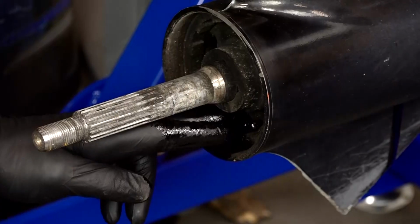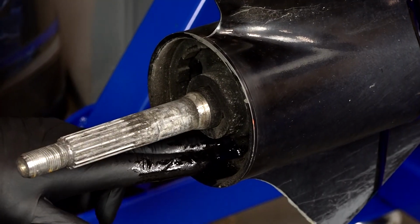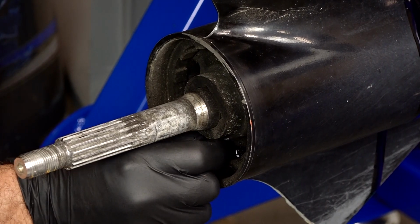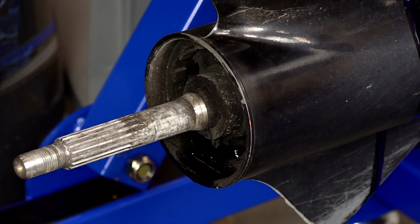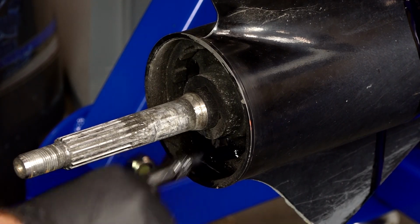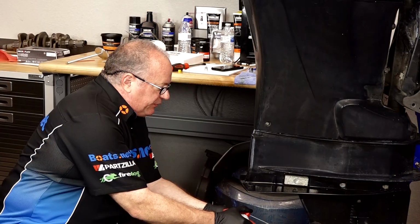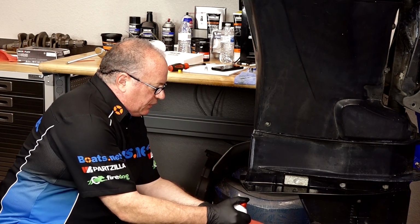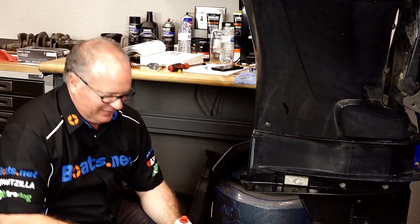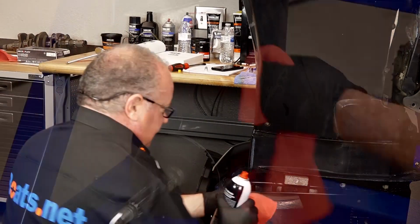Now, just want to unscrew our fill. Get our drain bolt, and in she goes. Tighten that down and just snug it just a tick with a 10 millimeter. Doesn't take much. A little bit of housekeeping. So we don't want to take the boat back to the water, drop it in, and then have a nice oil sheen as it glides into the water.